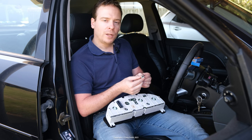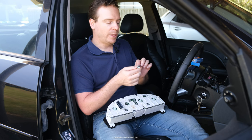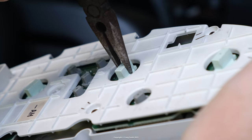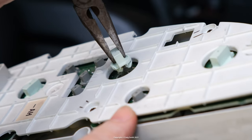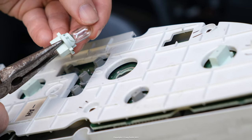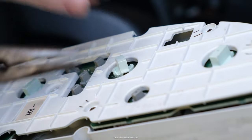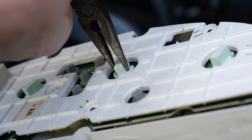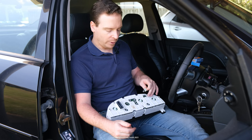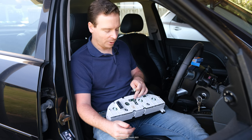You could still use LEDs if you replaced them with a white LED that emulated the originals perfectly. But then you've still got problems, because it's very hard to judge the brightness of T5 LEDs when you buy them. Most of them will just be overly bright, and it'll be very difficult to find one accurately described as equivalent — it should generate about 30 lumens and no more. So if you can find one like that, great, go for it — but I think you'll have trouble. In my case I couldn't be bothered, so I'm going to replace all four of the large bulbs, though I'm not going to touch the small ones as they're all still working, and I couldn't find the 0.9 watt versions anyway.